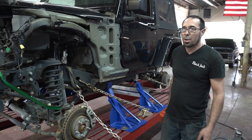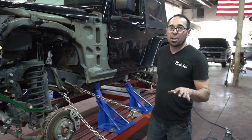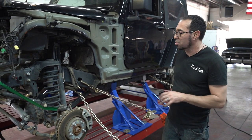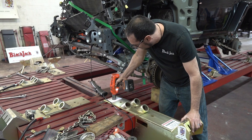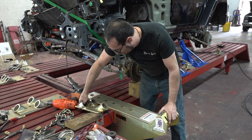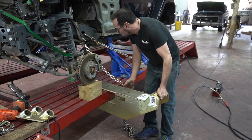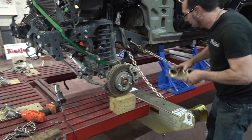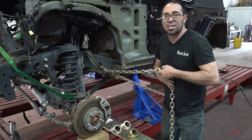Since this vehicle was hit so hard, we're actually going to set up a counter pull to make sure it stays where it's supposed to be — something you can't do with a lot of frame machines because you run out of pulls. Since we have five pulls, we'll be able to make this pull here, moving our side puller, which goes anywhere on the side or the front of the machine just by sliding off and moving over. We'll put our bolt back in place, our triple socket base, and we're using a soft strap to set up this pull.